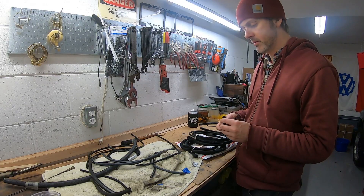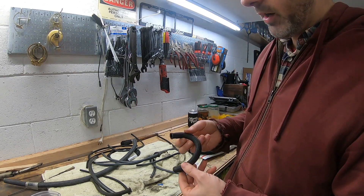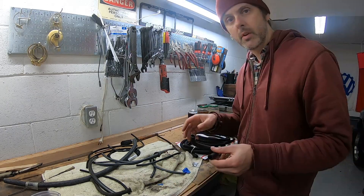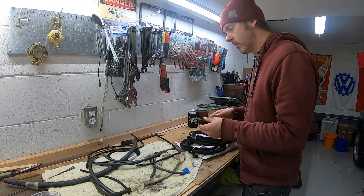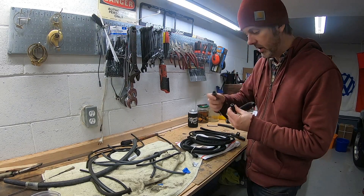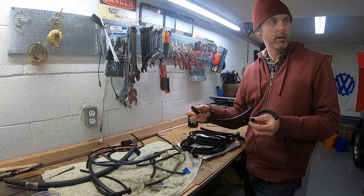One of the things I've been struggling with is that a lot of the hoses on this CIS system are braided hoses, and they are getting brittle. I'm really surprised that one didn't crack. I tried to cheap out and go to my local auto parts store to find some that looked like a relatively good fit — but it didn't work. I'll show you why.